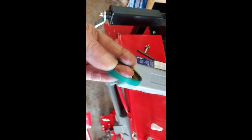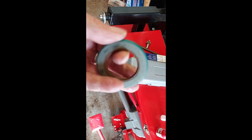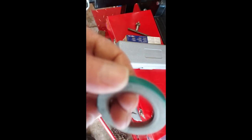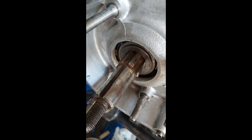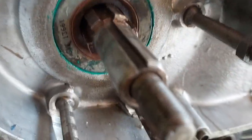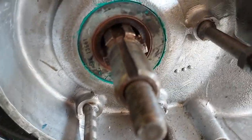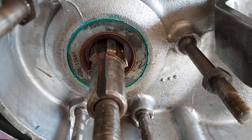This is the new crankcase oil seal. I put some Loctite 641 around the outside and then drifted it into place on the engine crankshaft. It went in quite easily with a trusty mallet and a length of wood - just going round it tapping and letting it slide in gracefully. It's all nice and flush now. I've put the original Woodruff key back in the clutch gearbox main shaft. This is the new clutch center - you can see the keyway for the Woodruff key. The wide end of the taper goes on the shaft first. I angled the Woodruff key slightly so it slides in easier, then located it on there and drifted the clutch center on with a big socket and mallet.